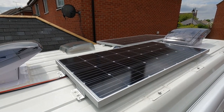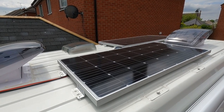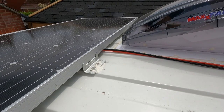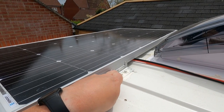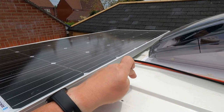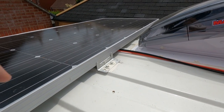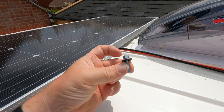Because I've separated them, it wasn't really possible to make any kind of rack or roof rack system, so I've had to just screw them straight down to the roof. I fixed the brackets that come from Renogy to the side, positioned and adjusted them so they sit on the high part of the van, not in the troughs. And I've just screwed them down with self-drilling screws from Screwfix.